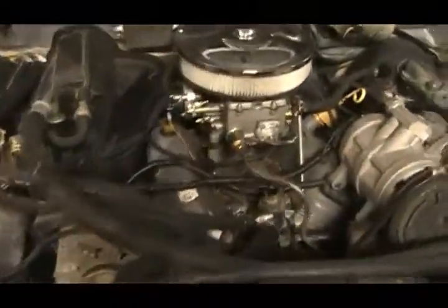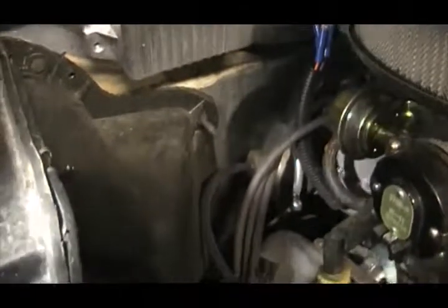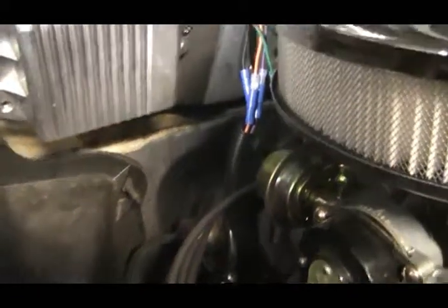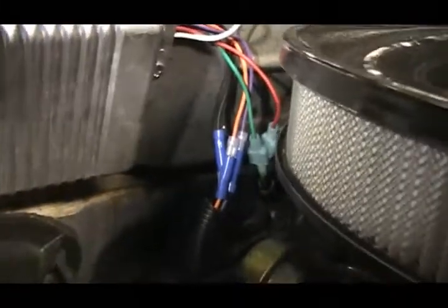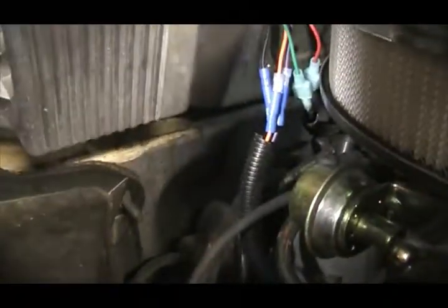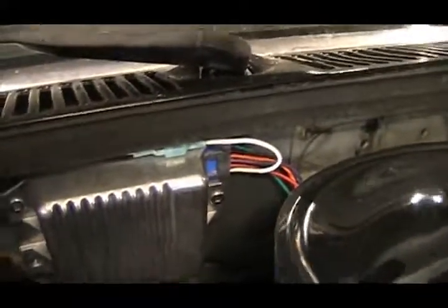We've got a regular two barrel. And behind there we've got our distributor that we showed you in the other video. There's that collar that they cut off to make the vacuum work. I had a GM ignition module screwed into that little plate right there. I couldn't get it to work — I think it was what it was accepting out of the distributor, which is the orange and purple wires, and then there's a black one there that's ground. So I went and got a DuraSpark blue grommet and proceeded to fix this thing the right way.